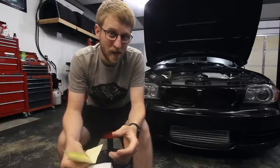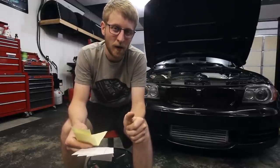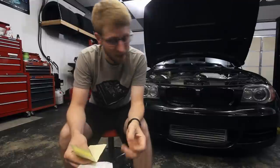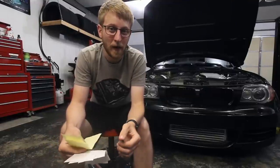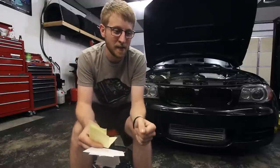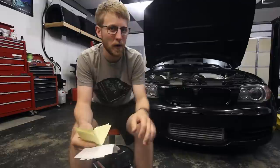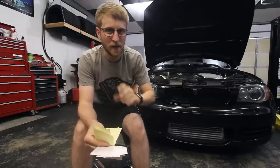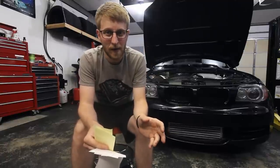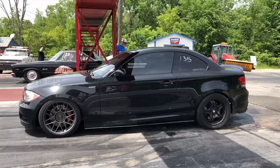So what I found out was, even though I wasn't pressing that button with the dial set to slip the clutch longer, it was still affecting my in-gear shifts. That stupid launch control device that I thought would work good was actually interfering during the following shifts after the launch. So what I did was I turned the dial all the way fast so that it was as quick of a clutch slip as you could possibly make it go. And what that did was it put it back to stock. It basically took that launch device out of the equation. I decided I'm not using it the rest of the day. I don't want it to be affecting my shifts past the launch, so I turned that thing off and forgot about it at this point.